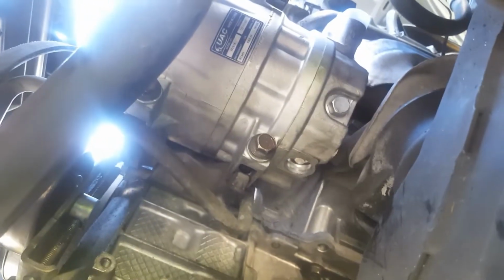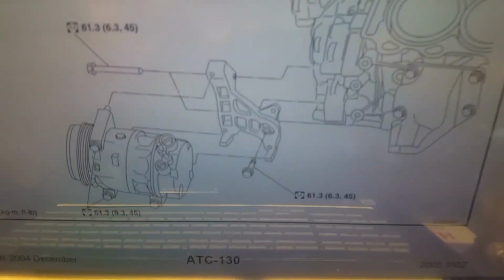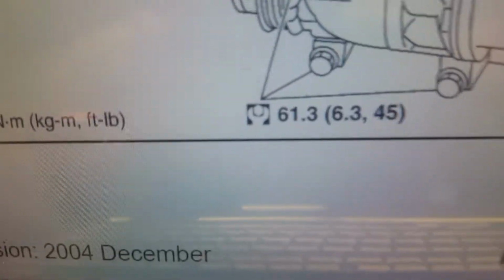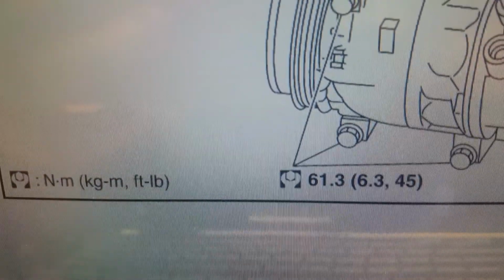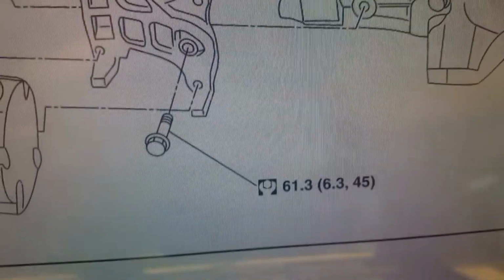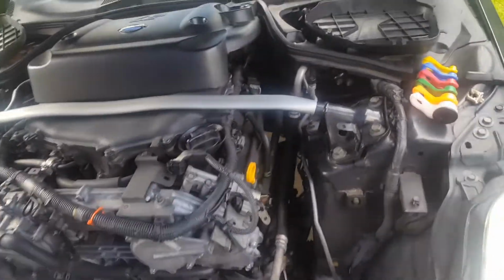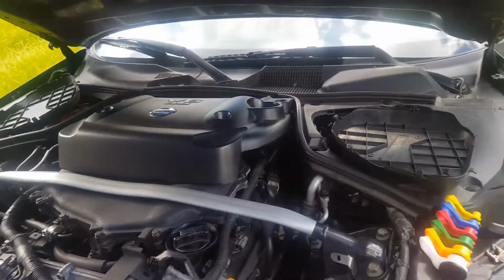Just tighten it up. I'm going to show you the torque specs for these bolts in the next video. The compressor for the 05Z gets 45 foot-pounds on each one of these bolts. Okay, 45 foot-pounds.